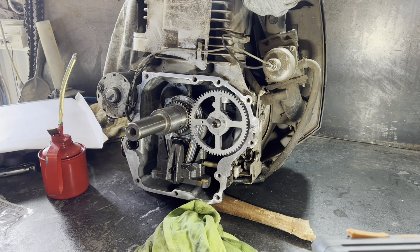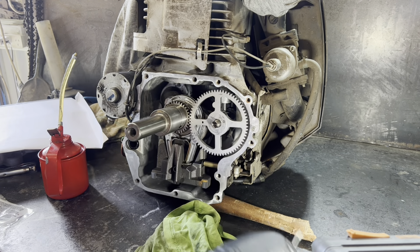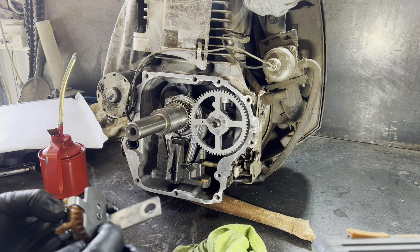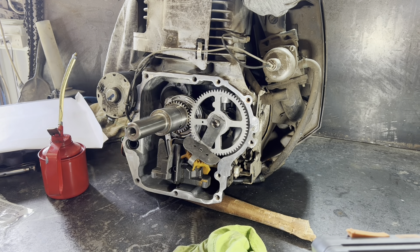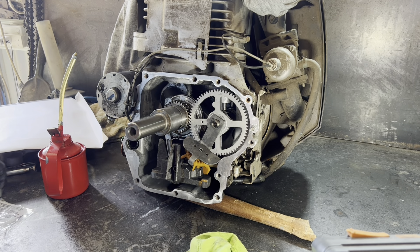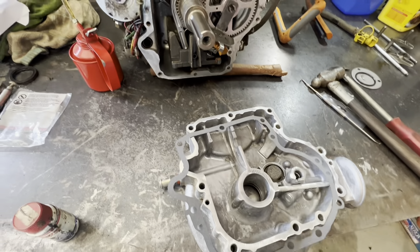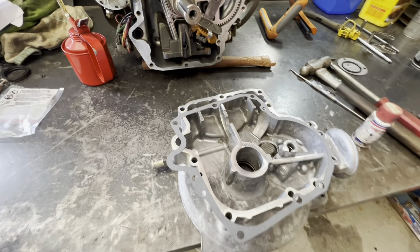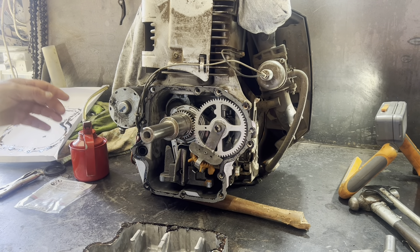Then those journals - it doesn't matter if they pop down. Now you can put the governor on. It goes on like that - that's held in close by the sump when I get it on. Here's our gasket. You can just put it on, they're fairly well good machine surfaces. I'll probably always put a bit of gasket material on it, just call it a second insurance, just on both sides. Got it apart, don't want to take it apart again. Gasket's on.